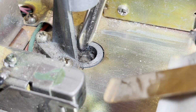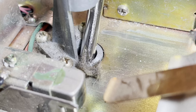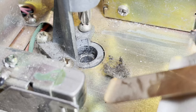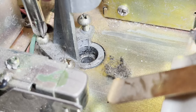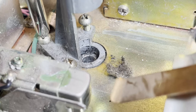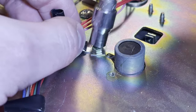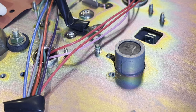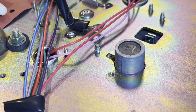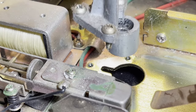I think the source of that vibration was that there's no grease or oil left in the bottom of that pivot - just dust and hair, which doesn't have a great coefficient of friction. I think it was causing it to bump around a bit. I'm going to remove this whole bearing pillar thing, whatever you would call it. This one screw does not want to move because it's actually on a nut on the other side, and that nut's just holding down this cable. With that nut out of the way, the screw comes up just fine.